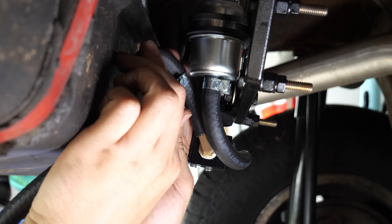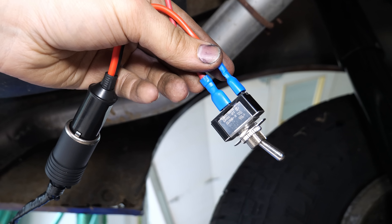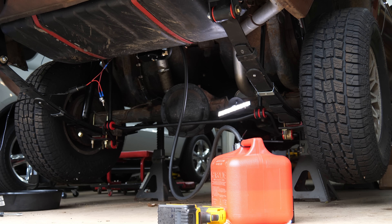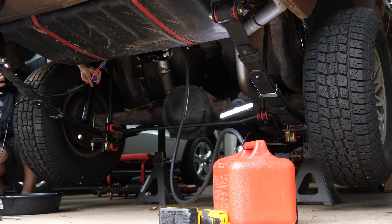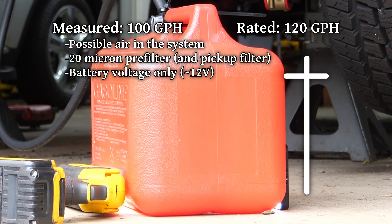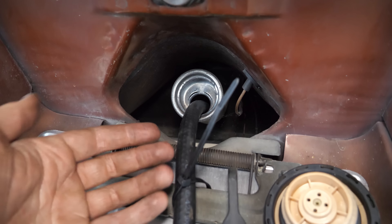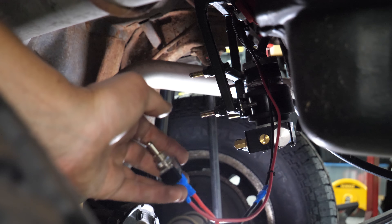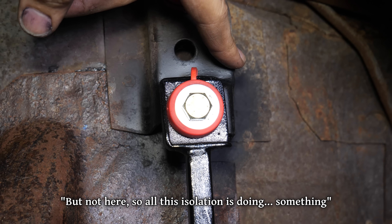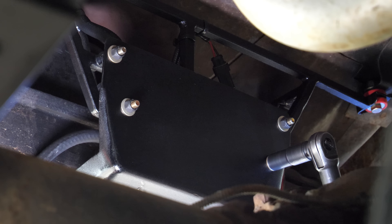Finally we'll add a long piece of hose to the outlet of the fuel pump and run that into a two-gallon gas tank so we can test the system — we've got the battery from the car hooked up to a toggle switch. The pump primed in just a few seconds and while it isn't exactly quiet, it's at least not completely screaming and it definitely flows very well. That was about 72 seconds to fill the two-gallon can, which comes out to 1.66 gallons per minute or 100 gallons per hour — pretty respectable, the rating is pretty spot on. For test number two — operation infinite loop — I really just want to listen to the pump running. Sitting in the car it's still quite noticeable, but I can feel vibration here and not there, so all this isolation is doing something.